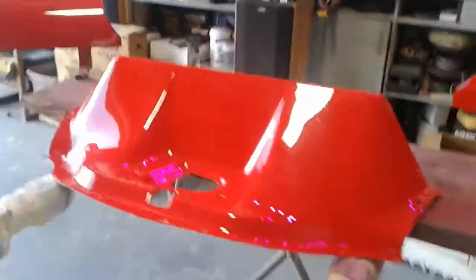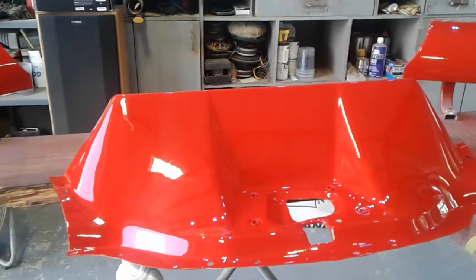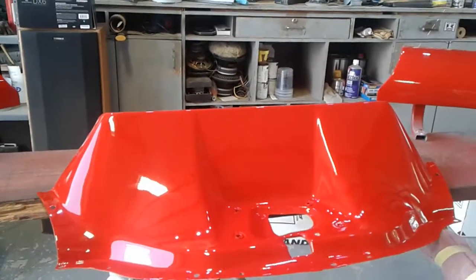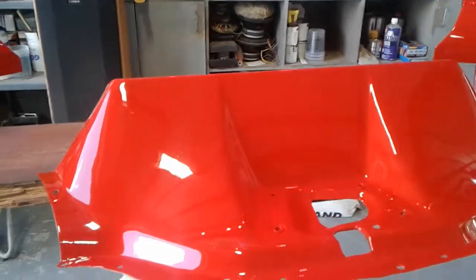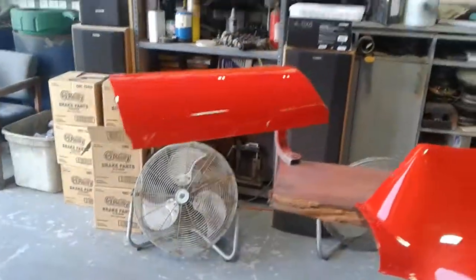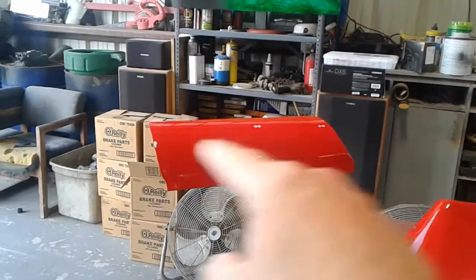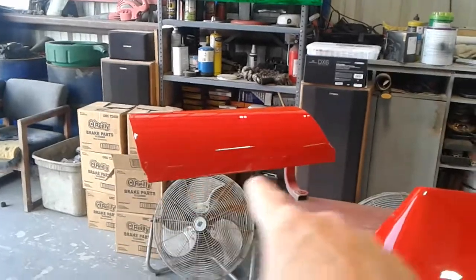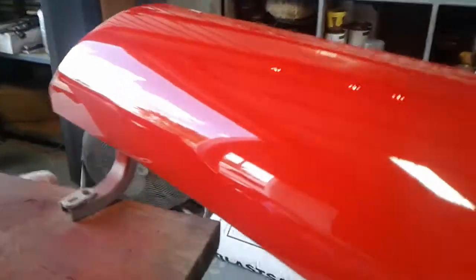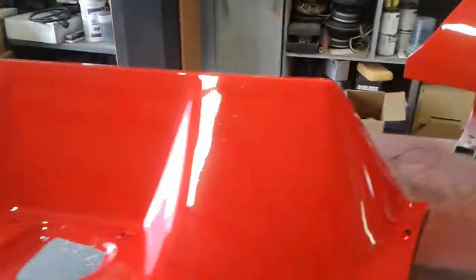Since I was painting red, I got out the hood latch and the under-hood radiator cover — shroud cover, whatever we want to call that — and got that in the red it needed to be. I also got the little escutcheon panels — filler panels — between the bed on this side, the cab right here, the rear fenders, and the running boards. Those came out looking really nice. I'll give those a quick wet sand with some 1200 and 2000, run the buffer over them.